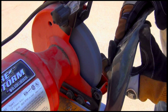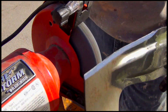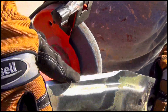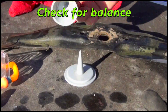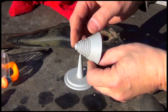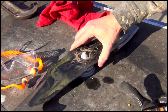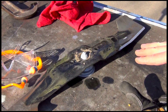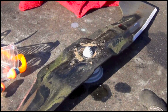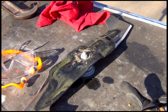That's looking pretty good already. You can see that this edge is pretty sharp — that looks definitely good. I think that's going to work. This little device here is a blade balancer. Basically it's a point with a funnel-shaped cone on top that has little grooves in here for the blade to fit on. You want to set your blade on the blade balancer, make sure you've got it even and sitting flat, and make sure that it's level — not too heavy on one side. If it's heavy on one side, go ahead and take it back on the grinder and grind on the side that's heavy. Otherwise you'll have some vibrations with the mower that make mowing no fun.